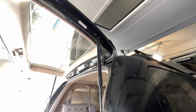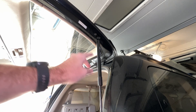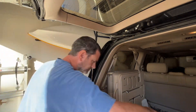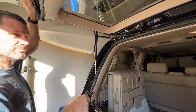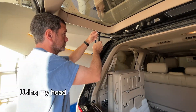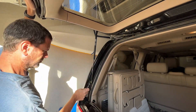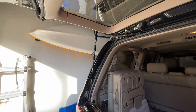Okay, this side's complete. I'll do the same to the other side. This should probably be able to hold the liftgate up on its own, so I'm going to take my vice grip off, but I'll support the weight just in case while I loosen the bolts on the other side. It doesn't appear as if a single one will hold the full liftgate, so I'm just going to hold this up while I'm doing it. I held it up with my head a little bit — it didn't feel good, but I got it done. Probably best if you have two people.